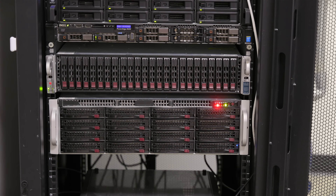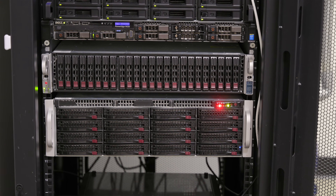Today we're going over how to replace a failing drive on TrueNAS. I'm going to be doing this in TrueNAS Scale, but it's pretty much the exact same thing in TrueNAS Core. We're going to first identify the drive, then go through the resilvering process to rebuild it. If you're using one of the community editions on your own hardware, you have a very specific way you have to identify the drives.